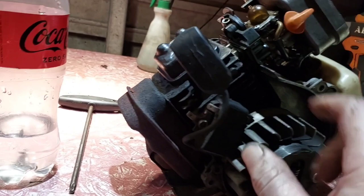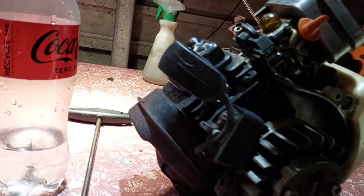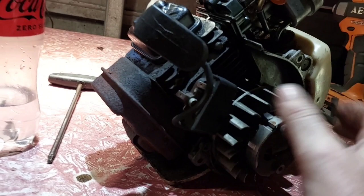It's got valves too, so I wonder if it's burned out a valve. I'll pull the muffler off, have a look at the cylinder, see if the piston looks weird. It's done some hours but it still should go — it really should. There's a pulse line that might be gone. I've dealt with these carbs before.